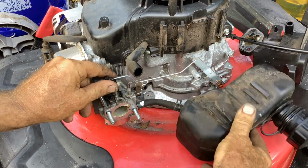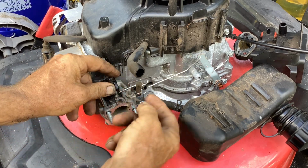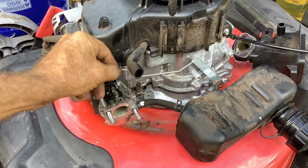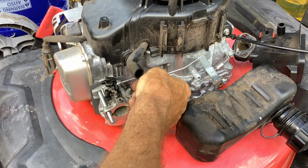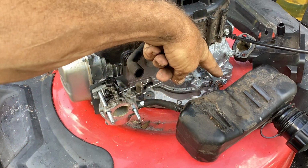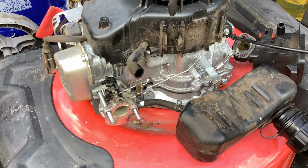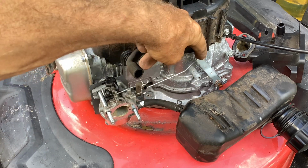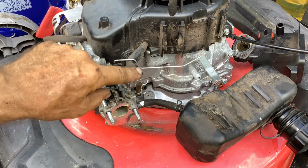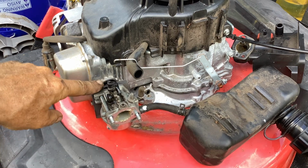The choke seems to be stiff here. So I'm just opening the choke full open and pushing up on the tab. That'll come off. There's no way to screw this up. It goes back in the same spot. So this looks kind of tweaked. I am looking at the distant cousin, and it is kind of on an angle. The Briggs are more upright than this. And it's in that number four hole on the cannibalized unit, so I'm not going to mess with anything there. Rest my linkage up on the breather tube. Go ahead and give this a little bit of a pull. Taking note how these gaskets are set up back here.